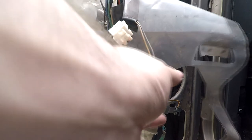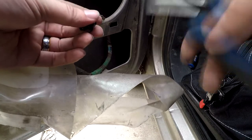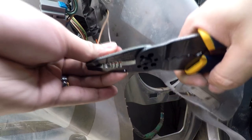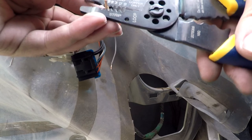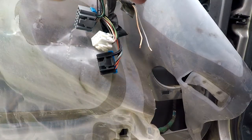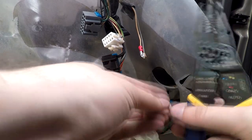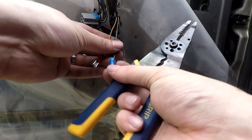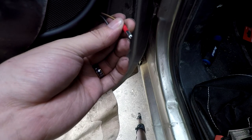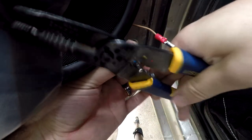We just need to move on to the wiring harness. We're going to snip off the old harness for the tweeters and then snip off the harness for the woofer. It's important to note that the tan is the positive and the gray is the negative wire. We're just going to strip the insulation — grab your favorite pair of wire strippers and remove about an inch. We're going to use red for positive and blue to signify the negative wire, and just crimp it using the wire crimping tool. We'll do the same to the woofer cables, using the appropriate terminal ends for your speakers.